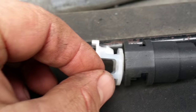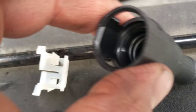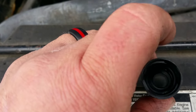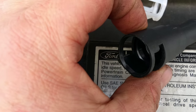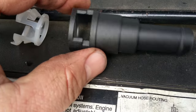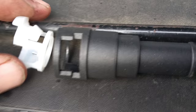When you do that, you can put the two pieces back together. But before you do, just know that there's an O-ring deep inside. You want to make sure that the O-rings did not stay on the pipes. If they stay on the pipes, you need to remove the O-rings and put them back into the black assembly. The aftermarket setup will be just the hoses without the Quick Connect, so make sure the O-rings did not stay on the nipples.